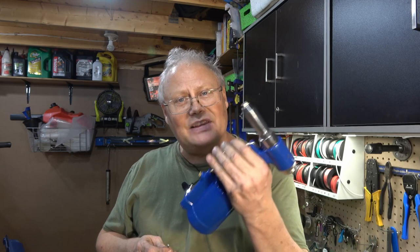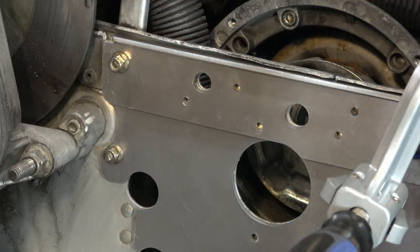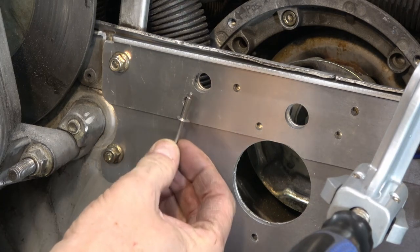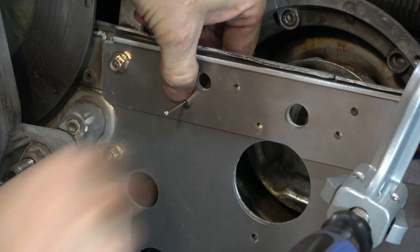That's one of the things when you do buy a kit like this, you need to understand you're either going to have to borrow or buy one of these things to actually have success and determine whether or not that'll work. But you do need to make sure that you understand these things are hard material. Using a 3/16 drill bit, I'll open up all of the blank holes and then insert one of these stainless rivets and a backing washer.